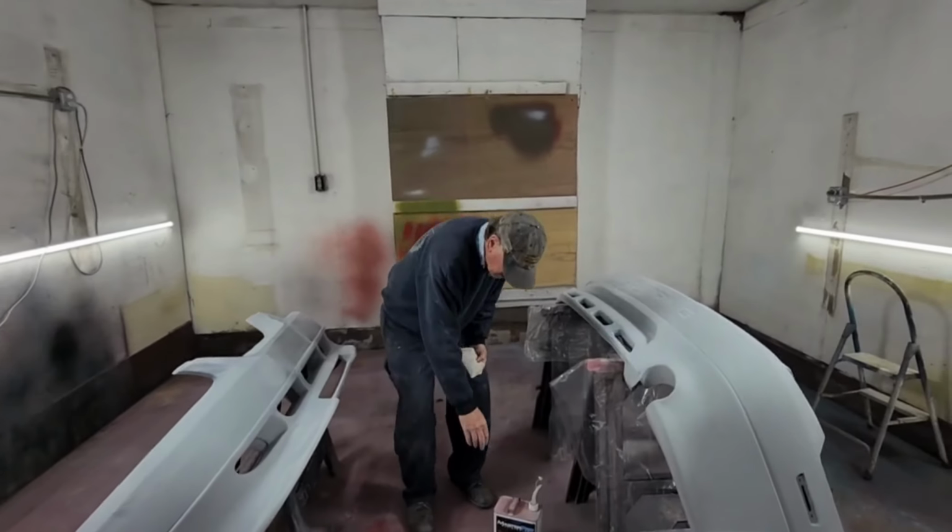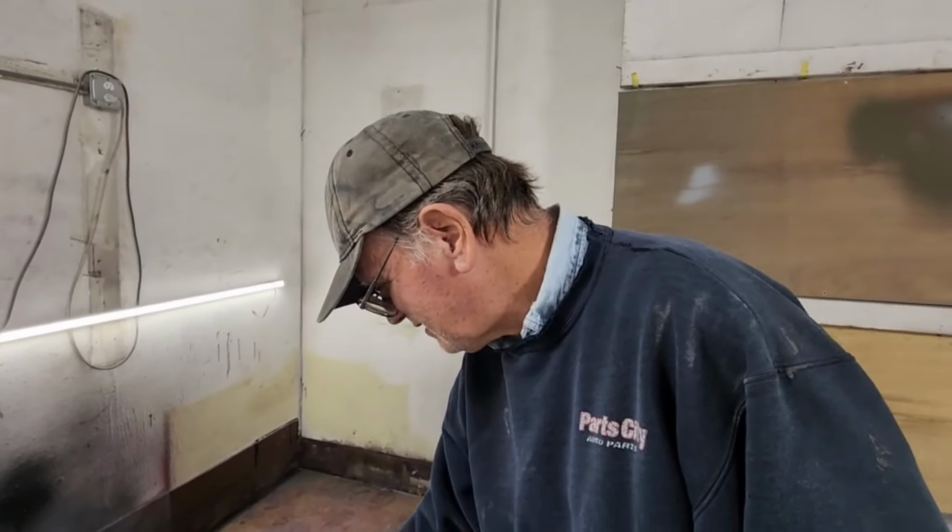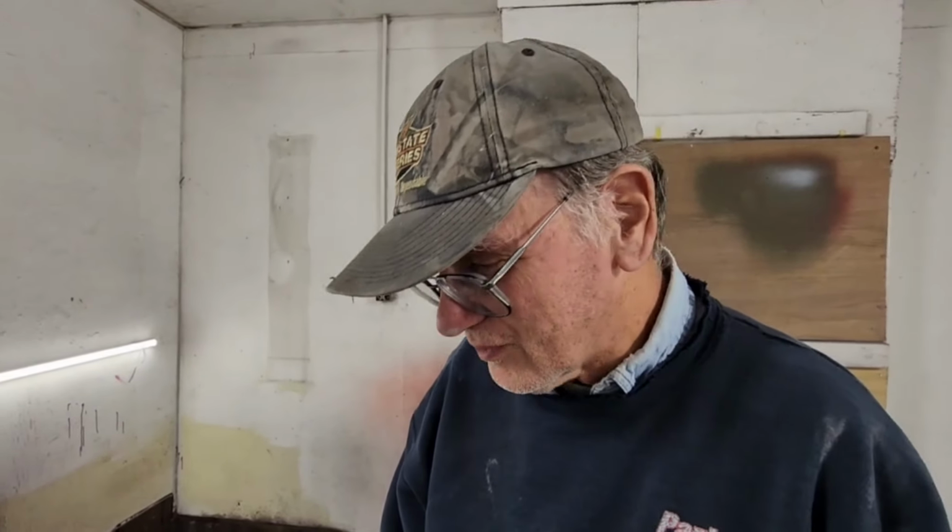We're out of paint and we're patiently waiting for paint. Johnny's mad. I was really mad yesterday. Why would a paint store sell you summertime hardener? No way. Yes, they sold us summertime hardener in the middle of winter. That's why we were having so much trouble with paint running. It was not drying. It was kind of bad because we were sitting there looking how pretty it was, and it just slowly started sliding down the door. Yeah, it was beautiful. We got her, boys. And the places it did run is really pretty.